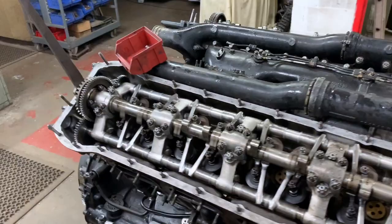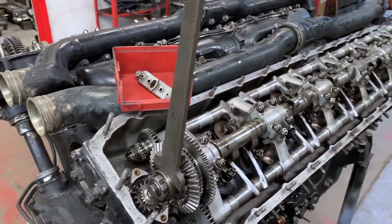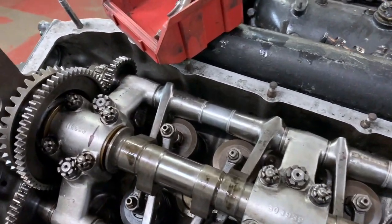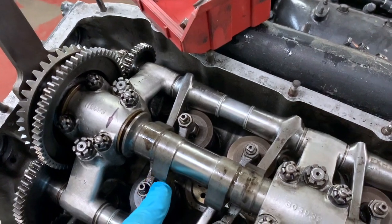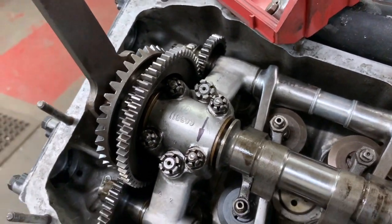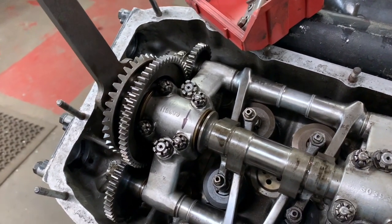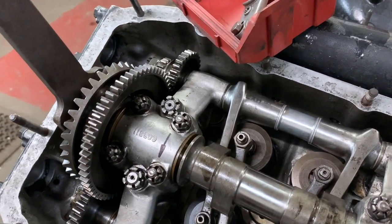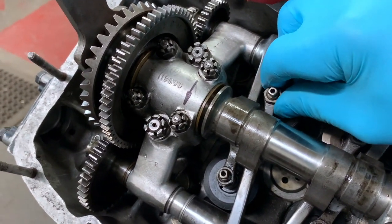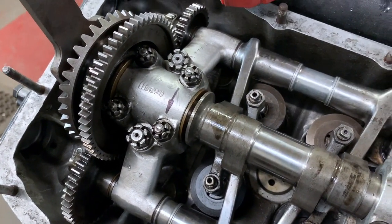We're going for the position where we now have to turn the camshafts. I've got this pin spanner here and put it in position. Very basically, what you're doing is the cam lobe is coming around — I've marked the direction of rotation because it helps me. These are the inlet valves here for cylinder A6, and it's just coming around until it's basically taken out nearly all the valve lash so there's virtually no clearance in there. You actually do it with a feeler gauge.